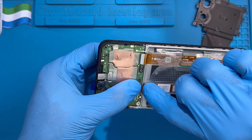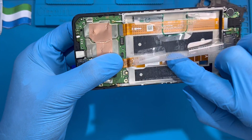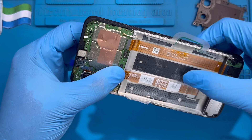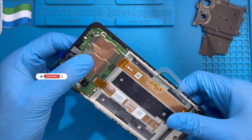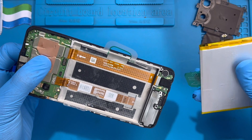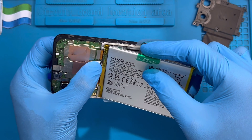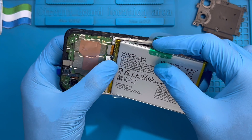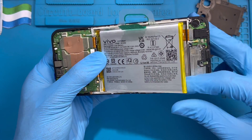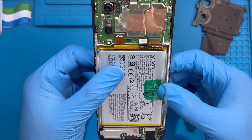Then make way for the battery to rest like this. Move this plastic back and close it. Open this one also. Then put back the battery. Make sure the battery is very straight. Fix the battery connector first before you put the battery down so you don't lose the position of the battery. Open this plastic properly. Make sure it rests properly. Close all this plastic.